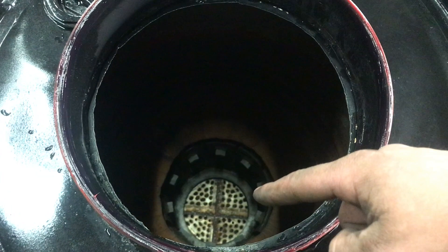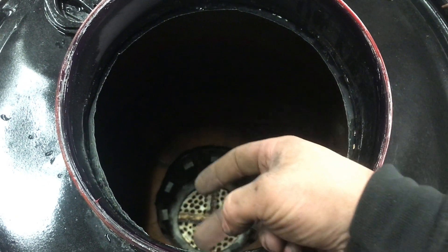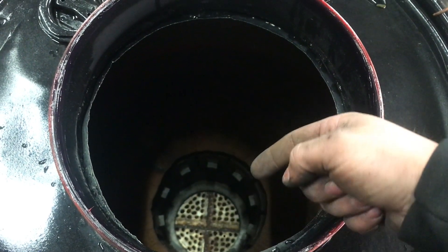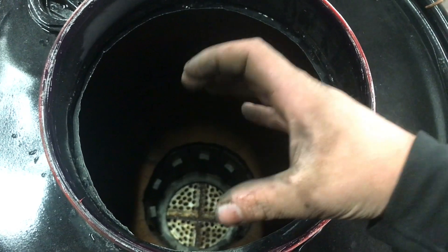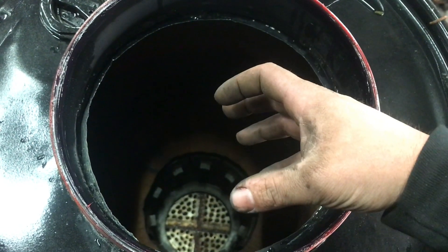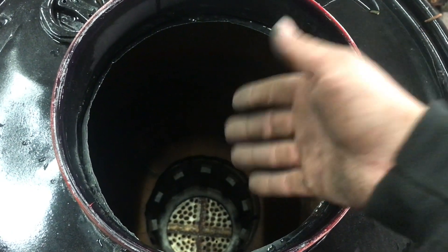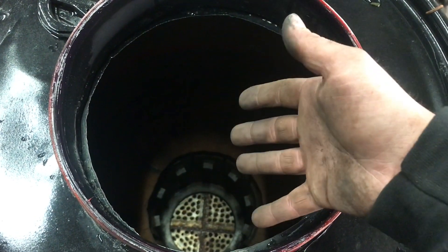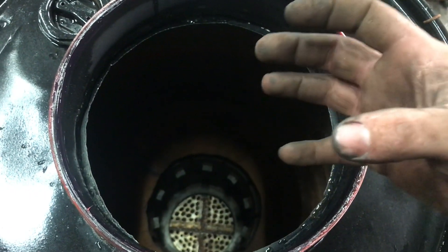Pretty much the last thing we need before we fire the system off — you can see at the bottom where the grate is, there's the choke plate flange hanging around the edge. But we need to choke the fire down into a smaller area, force it into hot charcoal, make sure we don't get any oxygen passing through there, or for that matter any tar. Try to get as much water out as we can in the hopper — we've got to force that fire down into a small area, get it good and hot.